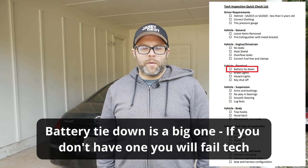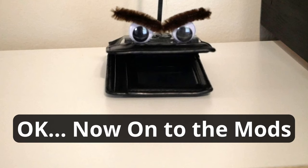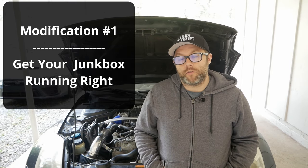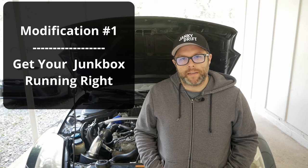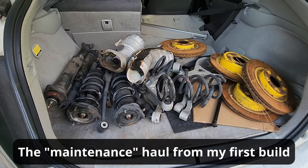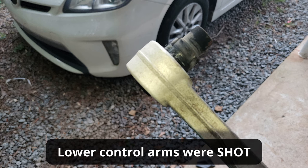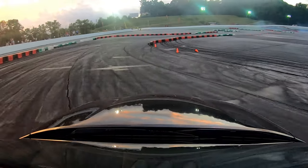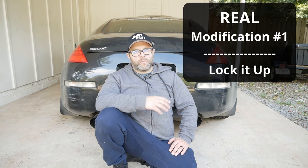Number one is going to make people groan, but it's maintenance. If you want a car that's going to run appropriately and not leave you stranded, you need to make sure it's properly maintained. Most of these cars we're buying to drift are over a hundred thousand miles and probably not well cared for because we're looking for bargains. So you're going to be replacing seals, gaskets, bearings, ball joints, and so on — because while those things might not seem like a big issue while you're putting the car together, once you get on track, little issues become big really quick. I've done about 15 events this summer and beaten the absolute hell out of this car, and the reason it makes it home is because I replaced pretty much every wear-and-tear suspension component.